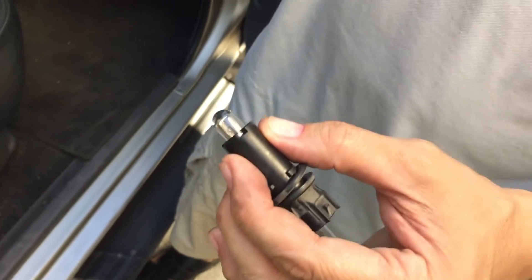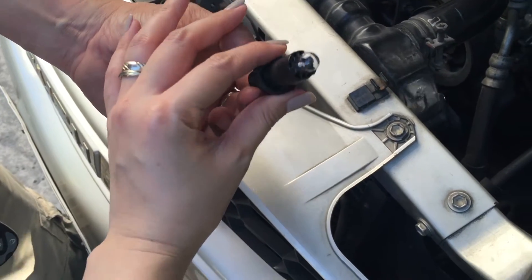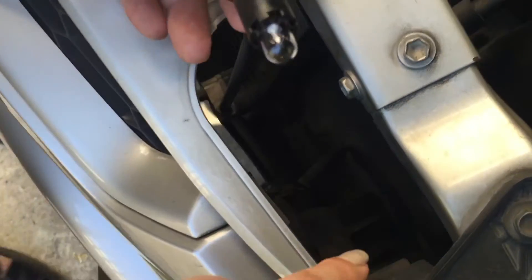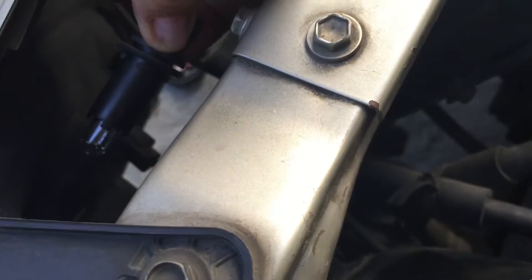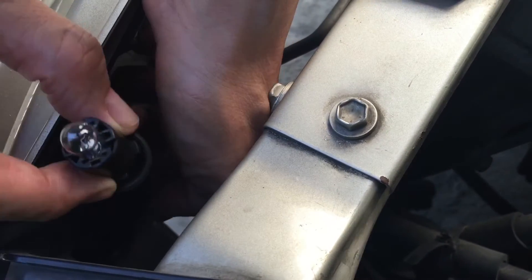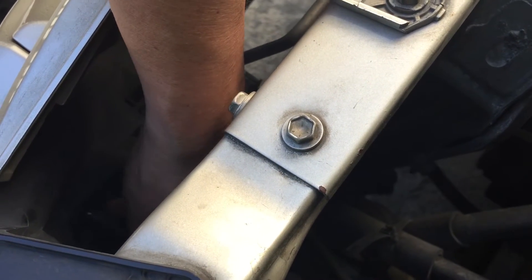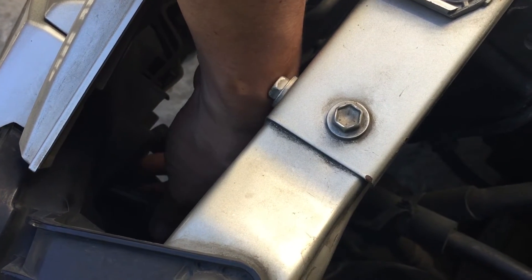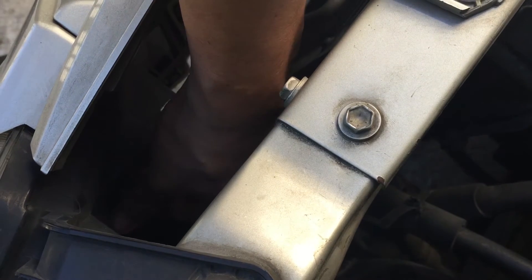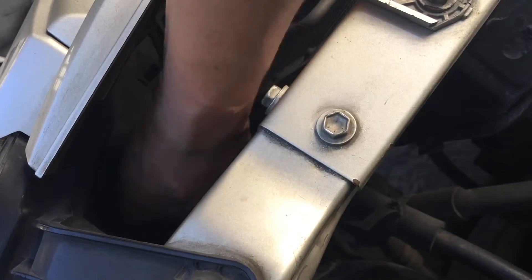Make sure it's really secure. After that, let's go back to the hood and install this one. Our replacement is ready for installation. You see this slot here on the housing — I know it's hard to see because it's dark, but you just put it back in there. Insert it into the same slot where the parking light goes, and make sure to secure it by twisting it clockwise — righty tighty, lefty loosey. Make sure to secure it clockwise.